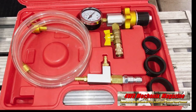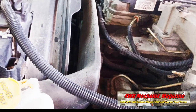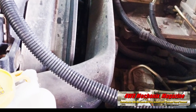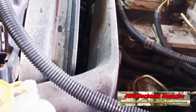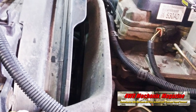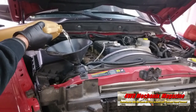When considering a vacuum refill siphon kit, take hose collapsing into account. This is what the long upper radiator hose on a Ram Cummins engine looks like with 20-inch height vacuum in the cooling system. You can see why I was reticent about using this method with older hoses. The hose did restore to proper shape when I released the vacuum, and this method worked fine when the hoses were newer. Pouring coolant mix into the radiator and recovery tank with a funnel is not a hardship.